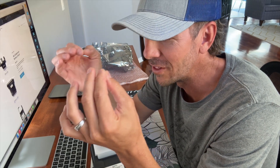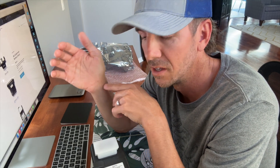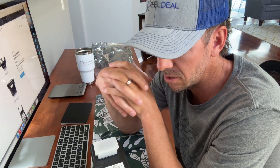The reason behind moving to 48 volts is that to push the same power at 12 volts requires a lot higher amperage across the wires, so you need bigger, thicker gauge wire. At 48 volts you can deliver the same power while pulling a lot less amperage, which means you can run a much smaller wire. So Tesla went from a big wire bundle and shrunk it way down — they reduced tons of wiring because of the 48-volt switch. Pretty cool.